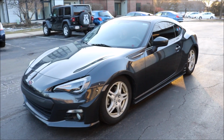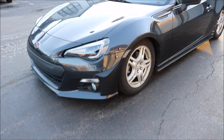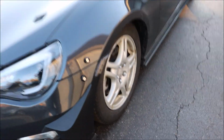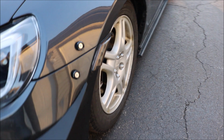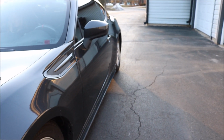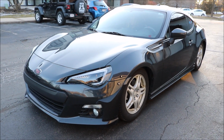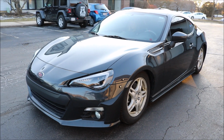But with the Fortune Auto 500 coilovers, I'm able to adjust it any way I like. And as you can see, my car has about -2, -3 camber in the front. In the back, it's about maybe -1, not too much in the back. And that's a perfect setup for my Work Emotion CR Kai Omnis that I have upstairs in my house right now. And I can't wait to put those on.